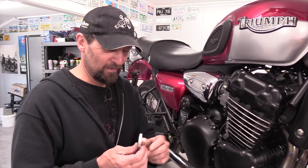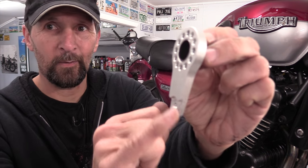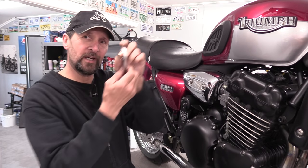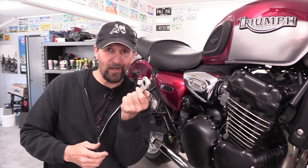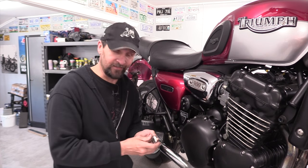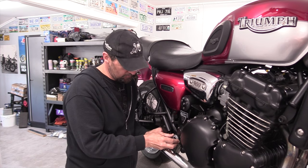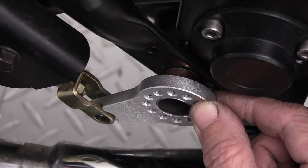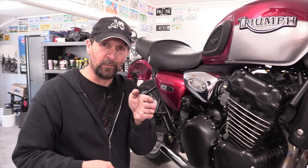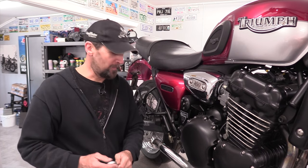That's the little actuator tab there. As you can see, it's got this cutaway, and that cutaway was falling just outside the clevis. I had this hope that if I just rotate it over it will fall inside the clevis, but it's just a bit too thick - it doesn't go in there. And when you bolt it up in the right position, it just pulls that little clevis rod to one side slightly, and it must be dead centre when at rest. So that's not going to work - an easy fix it won't be. Oh well, keep thinking.